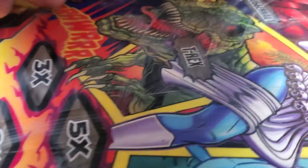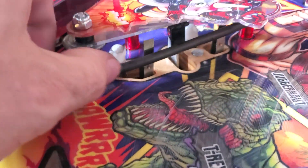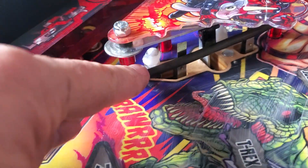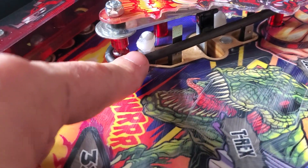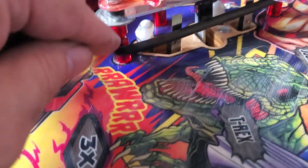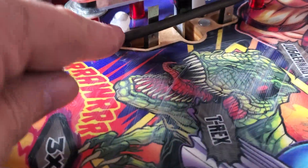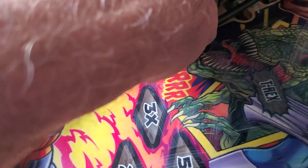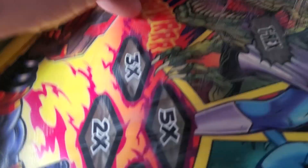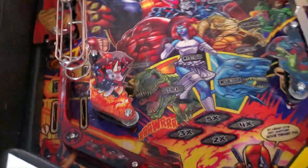The same thing on the other side. In this particular case, that bulb is off to the side, so the flex from the pinball — it actually can hit that ball. So the location of this LED is problematic. Maybe it should have been sunk a little bit lower or maybe it should have been moved further back. This thing is broken and I'm going to have to pull it out — it's literally in pieces. You can see it's broken apart there.